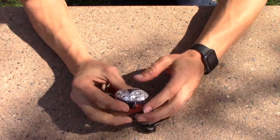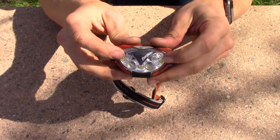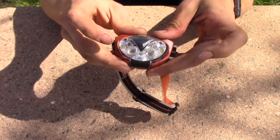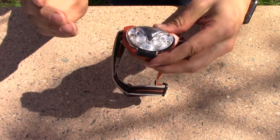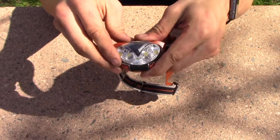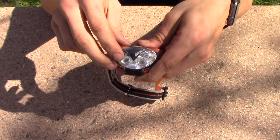It also has a three-stage lighting system — it's too bright out here to demonstrate well, but: first stage, the two main lights come on; second stage, both the main lights and the secondary LEDs come on, both white; third stage shuts the main ones off and gives you two red lamps. Red is nice because it saves your night vision and is useful for military applications, but the red LEDs are very small and not very bright, making them difficult to use.